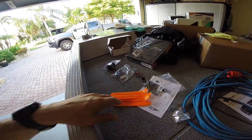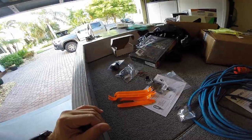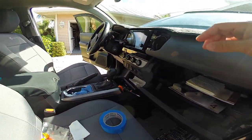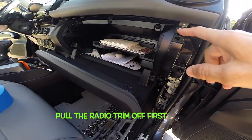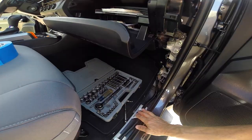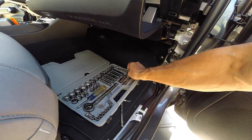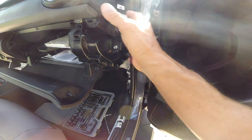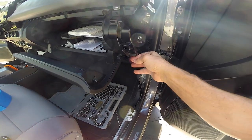Anything I've done with this truck, I've used these plastic prying tools. The next thing I did was loosen this screw here. This trim is held by a screw right here, so you have to take this out. But in order to do that, you need to take the floor trim off — the kick plastic on the side. You pull that out and then all this gets pulled out together. The side panel is actually clipped into the front trim here. And obviously, I've got to empty out that glove compartment.